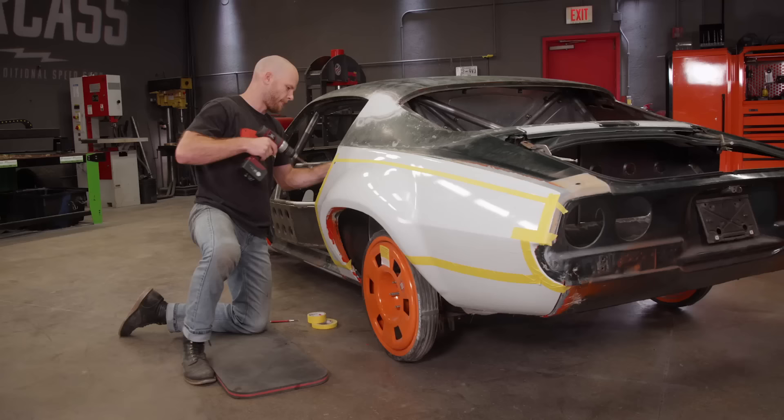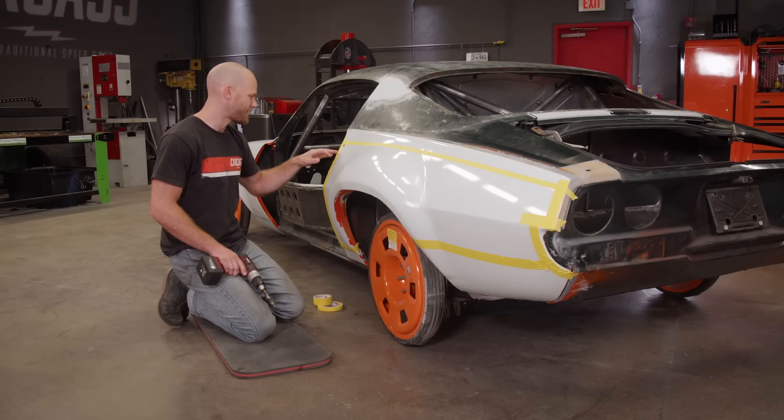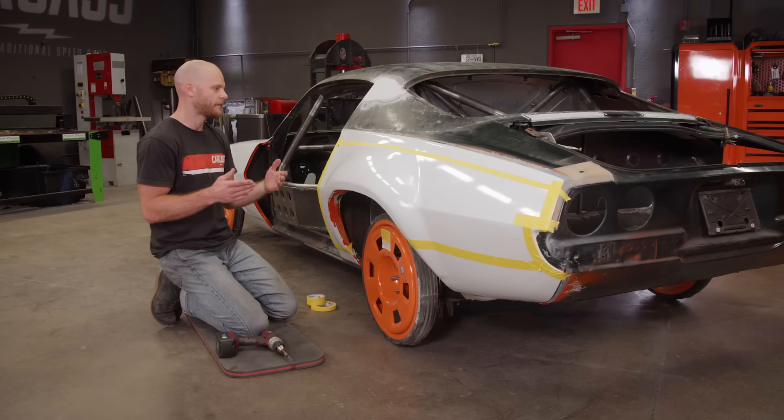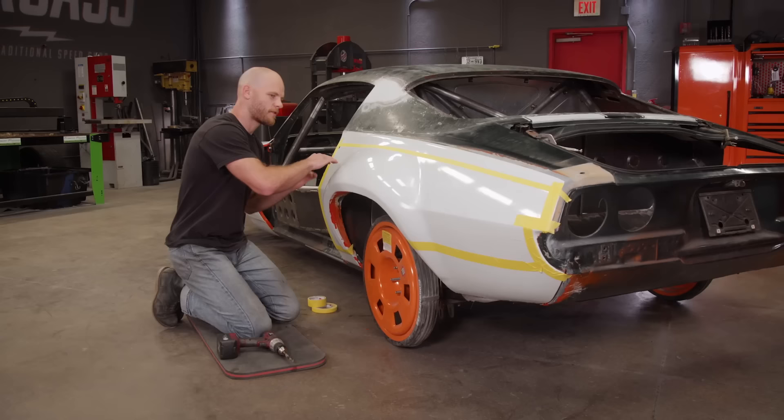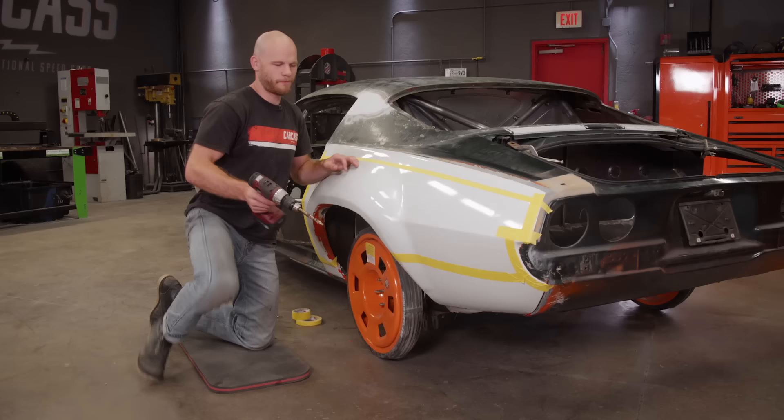So we've got this thing taped up. I've got a hole drilled, and I'll explain why. When we go to cut this, it's best not to have sharp corners up here because it leaves the metal more prone to cracking, especially with this thing vibrating so much. We just want to make sure these are nice round edges so it's less of a stress point. These lines may change depending on how we fit up our carbon fiber quarter, so these aren't the end-all be-all. If we want to grind and trim some stuff to move the lines back a little bit farther, we can do that too.